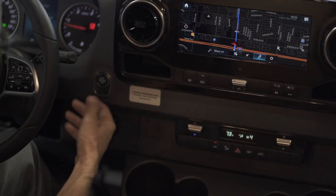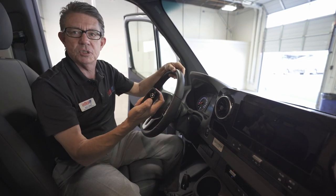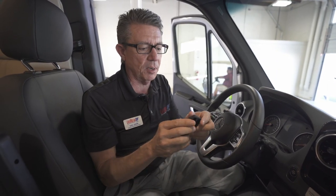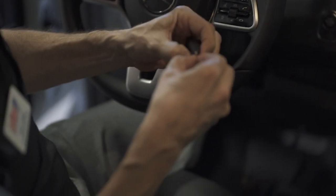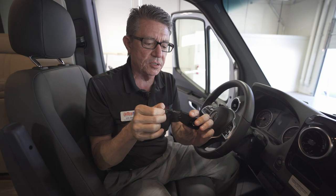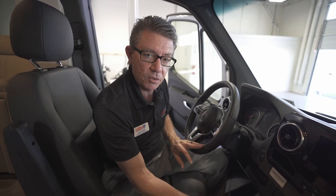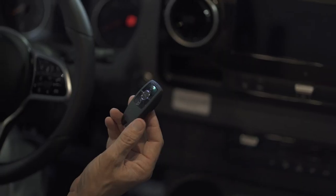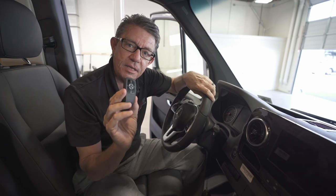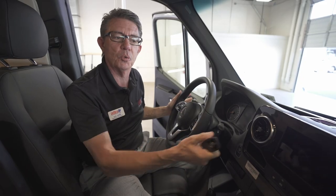I've now gotten back to my destination — I merely hit the button, the vehicle shuts off, and it's ready to exit. Regarding the key fob: unlike the old key fobs where you'd hit a little button and a key would come out like a switchblade, we don't have that any longer. However, there is actually a key inside the fob for an emergency starting situation — if the fob goes dead, you still have a regular manual key. One important note: don't leave the key fob sitting in the vehicle, as it automatically connects and the vehicle stays listening and waiting, causing a power draw. Keep the key fob away from the driver's compartment when you're not operating the vehicle.